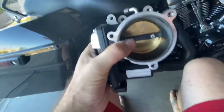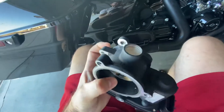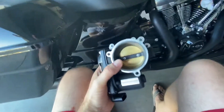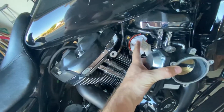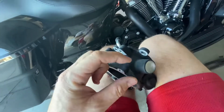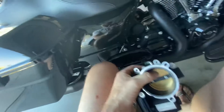What had happened was I put the wrong screw in here, and I cracked the throttle body. So I JB welded it because I had a plan to ride this over to Harley and let them fix it for $250 — that is with me bringing my own part. I cracked it and this fell off. I JB welded it; it's actually pretty strong, but it's not what you want to do. If this thing breaks off and gets into your intake, you're going to mess up your engine.